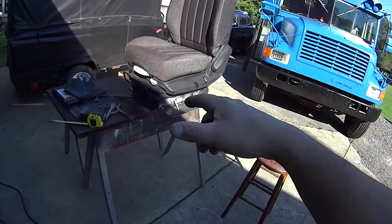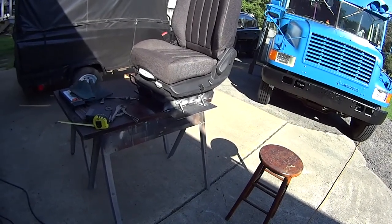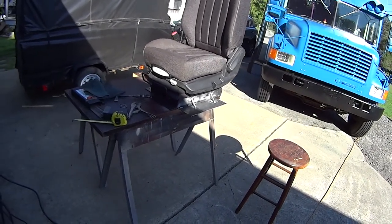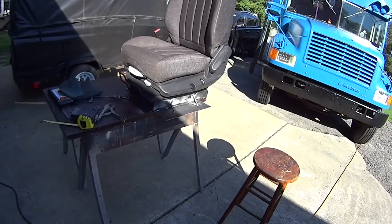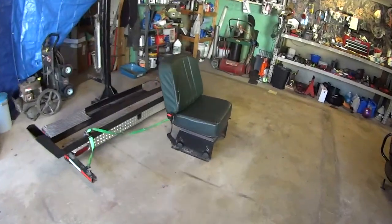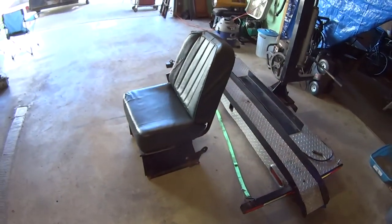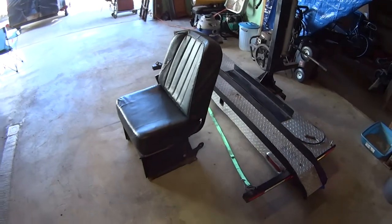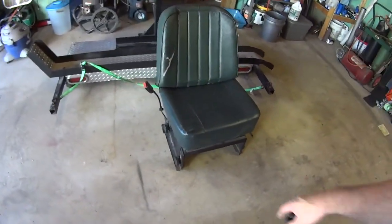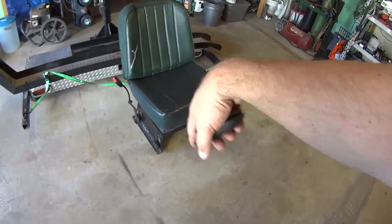So if I had drilled new holes, they were just going to be in not-as-thick metal, and plus where I'd be drilling them would be kind of hard to get your hands up in there to put the bolts through and nuts or whatever. So this is the old stock seat — you can see the base on it. It is adjustable, but it just ain't comfortable no matter what you do. There are two bolts on either side. I measured it, and the perimeter — running this way — was about 19 and a half inches wide by 16 inches deep.